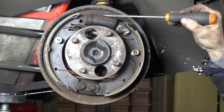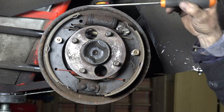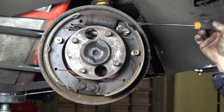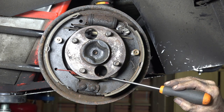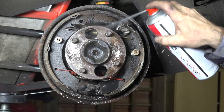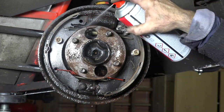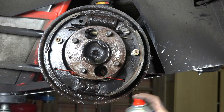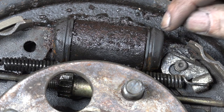I still need to work on the rear drum brakes where I'm going to replace the brake cylinders — you've seen how badly corroded they are. This is a drum brake and this is the cylinder we're going to replace, so we have to take the whole thing apart. You'll see there's an adjustment inside that allows you to open up the brake shoes more or less. There's a heavy spring on the bottom and also a cable for the handbrake. There's a lot of dust inside but you can use whatever you want to clean it. I don't like blowing them out with compressed air because that makes nasty particles airborne.